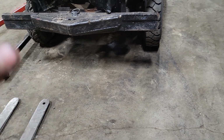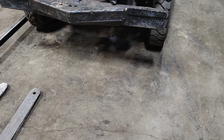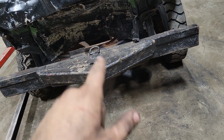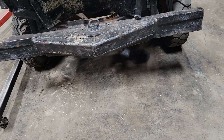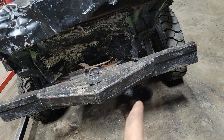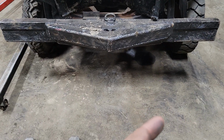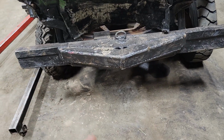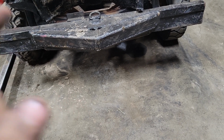It pushed back probably, I think we measured a 1/2 inch is all. And I ended up getting Mad Dog, the bumper sat too low, so I got cleared. It shoved the radiator in, and then I got pushed over the wall a second time, which I just called it quits then because the cradle I had and my steering shaft were hitting. So next time I put it together, I'm going to have a different cradle or a different steering shaft, and then I think it'll be good. I'm going to do a lot of A-arm work the next time I run this car, so the bumper sits a lot higher than it does, because that was the issue where I was running.